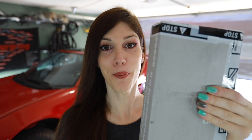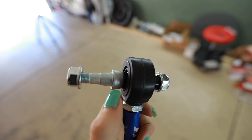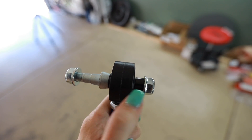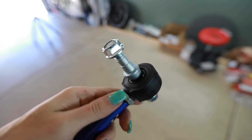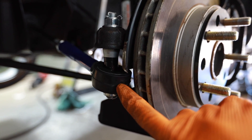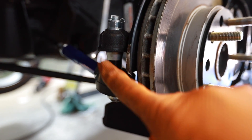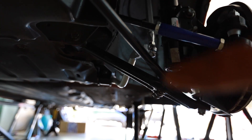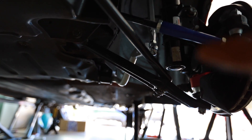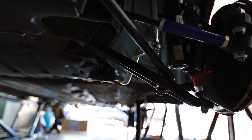This box just finally got in the mail — these are my bump steer correction front tie rod ends. The only company I could find that still makes these for the MR2 was Megan Racing, which offers 5 to 15 millimeters of adjustability, so I bought these — not sponsored. There's a spacer here and a spacer here: 5mm, 10mm, and if you put both spacers on the side you need, it gives you up to 15 millimeters of adjustability, so I can correct the geometry on the tie rod end to the same angle as my lower control arm. These adjustable front tie rod ends utilize a heim joint, and I have both the 10 and 5 millimeter spacers lowering the overall angle of my tie rod end to match the same rake as the lower control arm. There's a little deviation in the angle, which is actually how it was from the factory too, so once it's on level ground I should be able to do final adjustments.